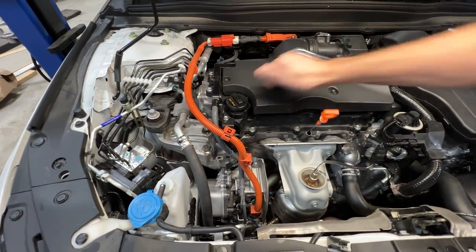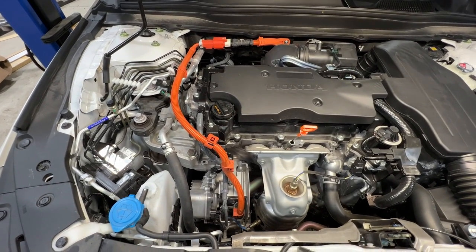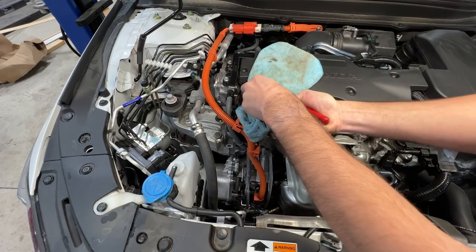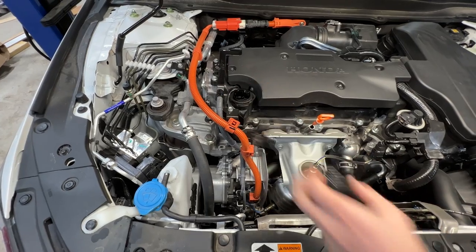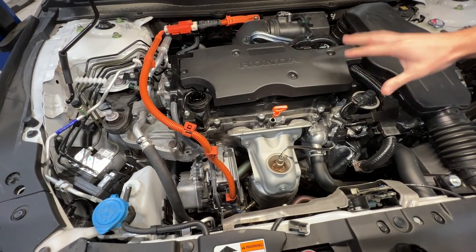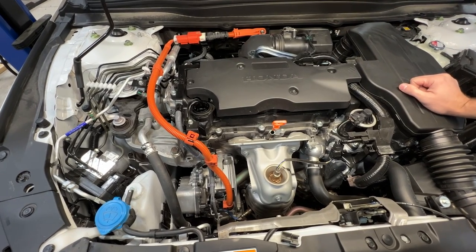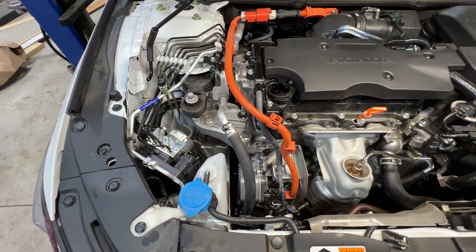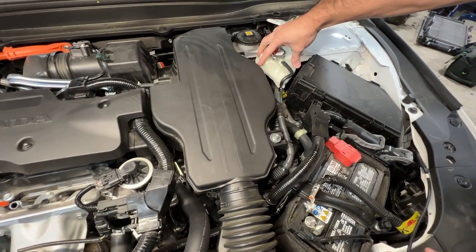If you're seeing orange under the hood, that's normal and it just means stay away — that's high voltage. Except they also use orange on the dipstick for some reason. We'll start by, just like every oil change, loosening the oil cap. This engine is going to take 0w20. This is a pretty low mileage car being a 2022, but you'll want to inspect certain things. There's also an inverter coolant reservoir over here — this is for the hybrid systems. You want to make sure that you have coolant in this reservoir as well.